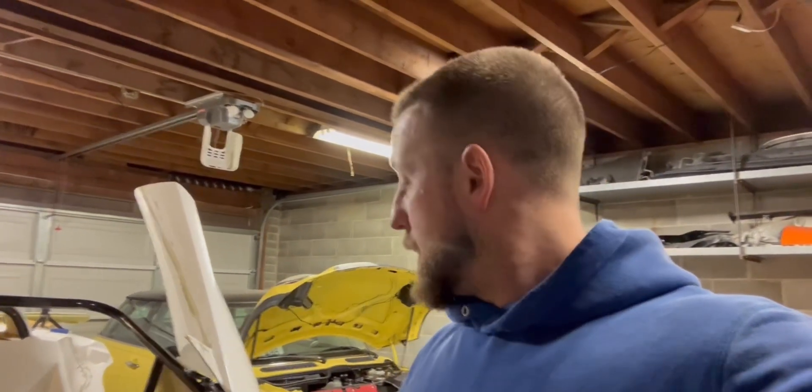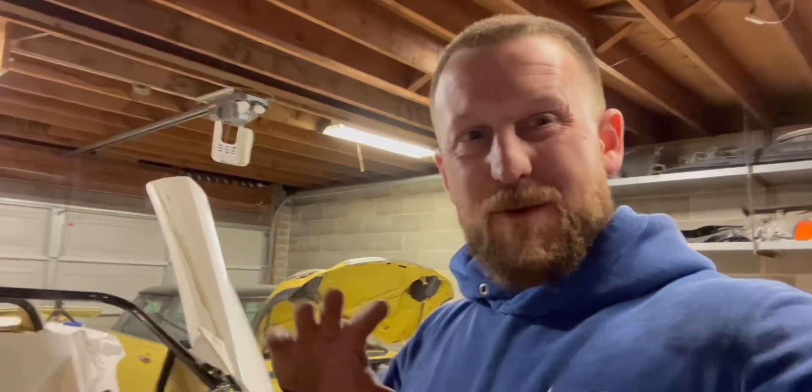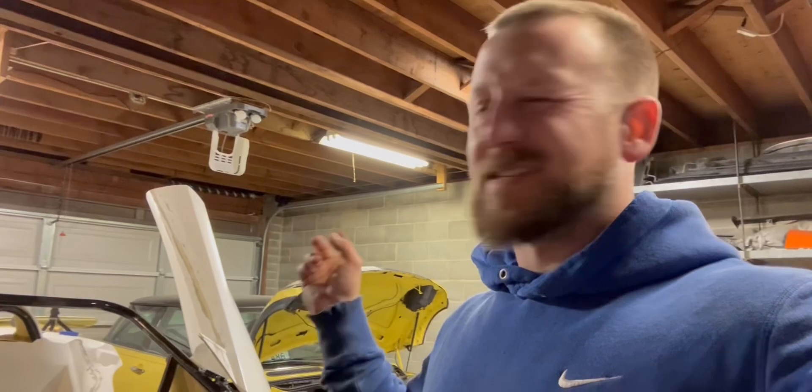The door is a problem — last time I had it mounted and lined up pretty well, but messing with the shock has screwed everything up. I haven't even touched the other side yet. I did order two replacement shocks: one is 60 pounds and one is around 50 or 45, down from the current 75-pound unit. Hopefully one of those will work and solve the problem, otherwise it's back to the drawing board. Hopefully next video we can try those out — like, subscribe, peace out.